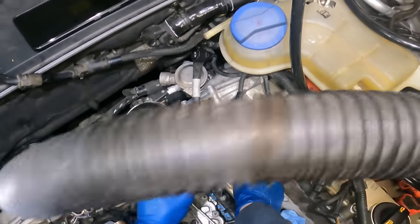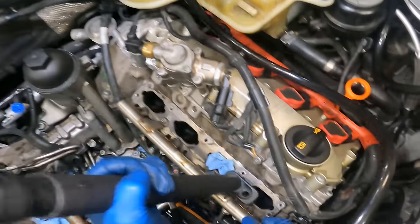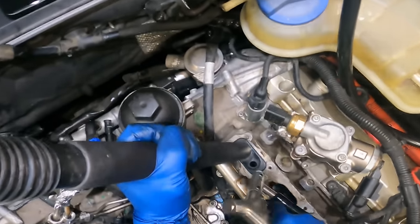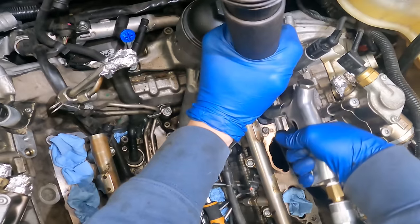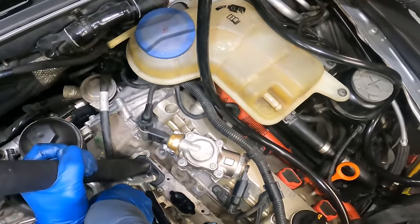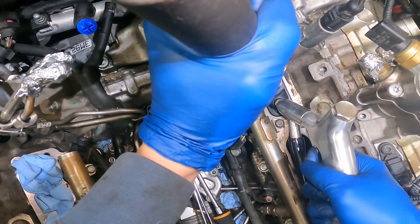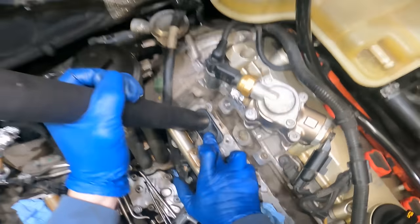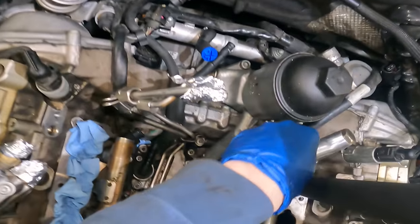And probably pretty obvious at this point, you're just gonna take the vacuum and come back through and repeat the whole process you did on the passenger side, on this side now. Grab the blaster and get in all your corners. And one helpful tip with the blaster too, before you get into it, if you make a tip that's longer, you can look them up. They have like Walnut Blasting tips. They kind of just go out and they give you a little bit of an angle. It'll make it easier to get in here without the handle hitting the vacuum, if you see what I mean. It just gives you a little bit more room to make it a little more accessible. Either way, this will still work just fine.